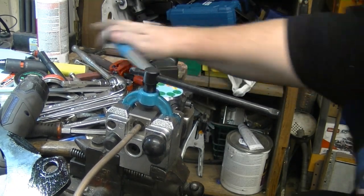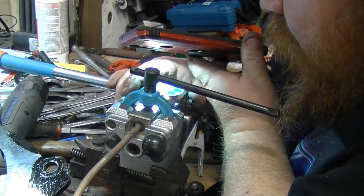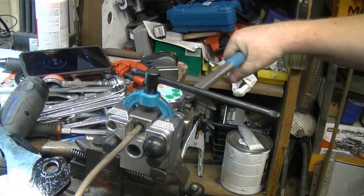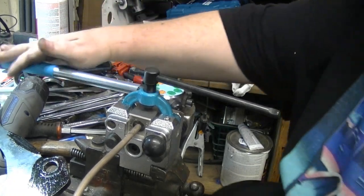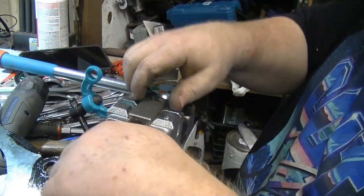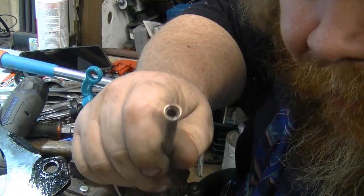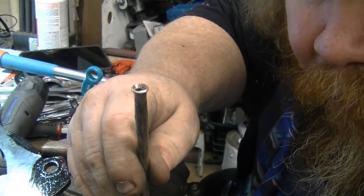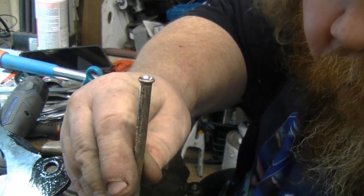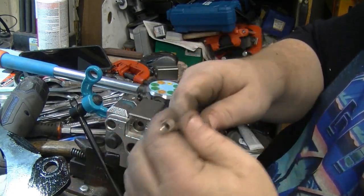Give it a pull, go to operation 2, verify this is 1/4 inch, that is 1/4 inch. Another pull until it stops. Back off your clamp, pull the pin, pop it out of the dies, and ta-da! Beautiful, uniform, straight, even flare. That's how simple this thing is to use. But I mean, it does beautiful work.